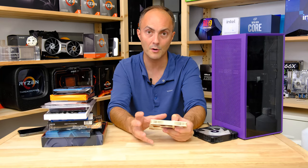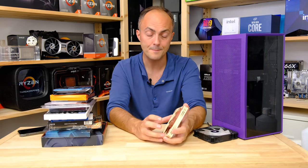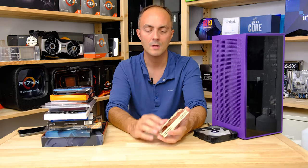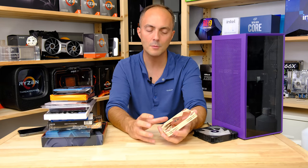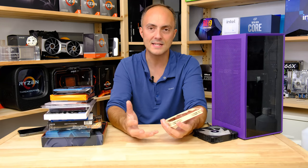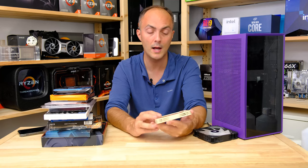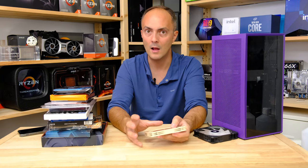So that's pretty much it from a testing point of view, the actual hardware. But the actual testing results, what I actually want to go through is getting each fan tested at full speed. Obviously, they're all different full speeds with these fans. I think there's probably like 7 or 8 different maximum RPM readings for the fans. And the reason for that, even though it's not directly comparable, is that basically in a mini-ITX case, you want to have the ability to ramp up the cooling and ramp up the airflow when you need it. If it's a hot day or you've got a really high-end PC crammed into your mini-ITX system, even if it's undervolted, you still want to have the airflow there when you need it.